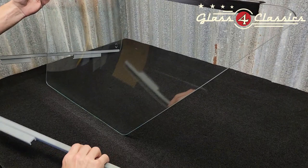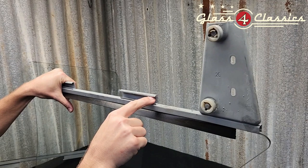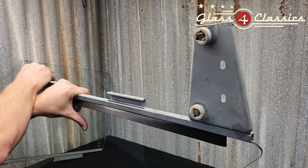Remember, this bracket always runs to the front of the glass. If you are doing a rear door glass, exactly the same principle — this runner is at the front edge of your glass, and these C-channels here are facing inside the vehicle. We're going to line this up; you want roughly 10mm from the end of this to the end of the glass, front and back. That way you know you're in the right spot.